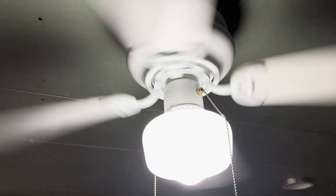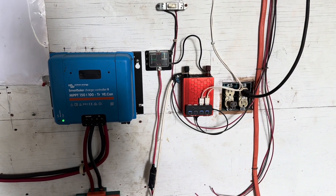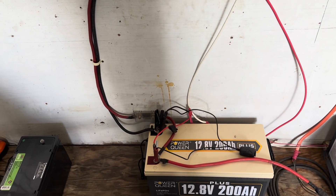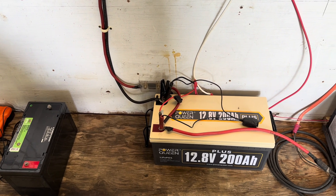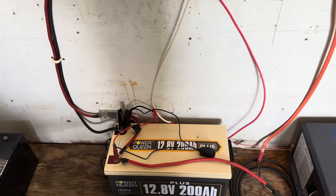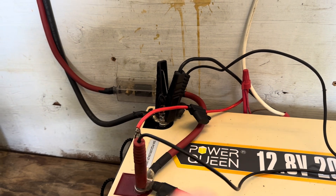It's keeping his living space at a very nice temperature — it could get a little warm back here but I'm standing under the fan right now and absolutely comfortable. The difference of lithium iron phosphate compared to that lead acid battery — as all of you know who use this chemistry — that lead acid battery over there, even though it's 100 amp hours, there's really only 50 amp hours of usable power. With this 200 amp hour lithium battery he has 200 amp hours available.